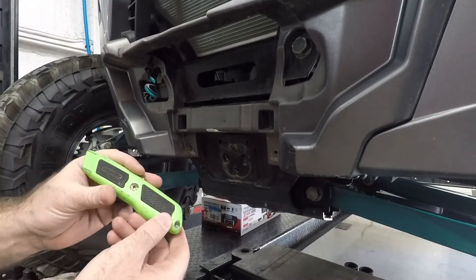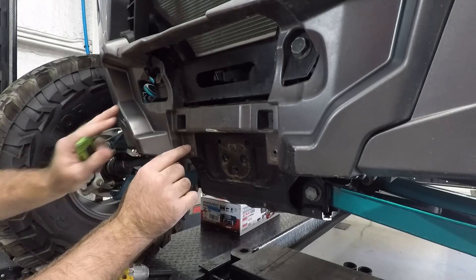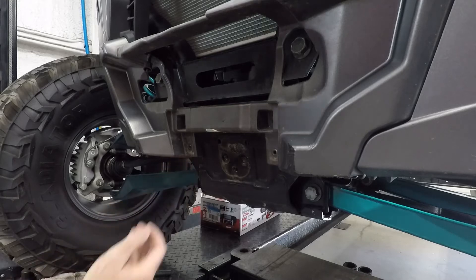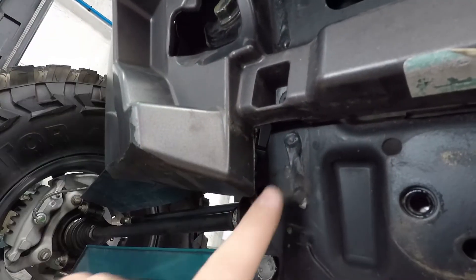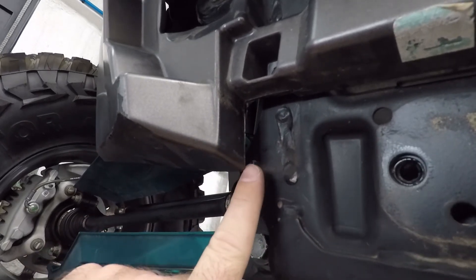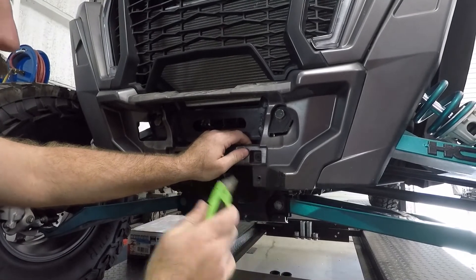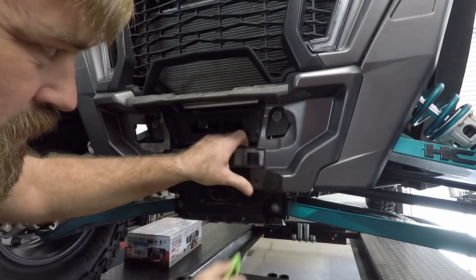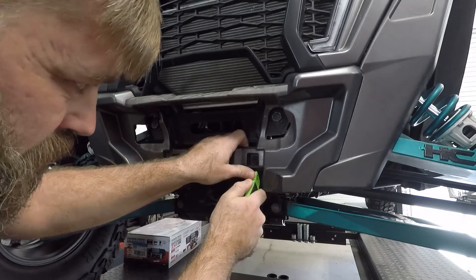The next thing we need to do is use a razor blade to notch the plastic a little bit. These corners right here where those Torx screws went through to hold that front plastic piece on — you need to cut those off. Down under here, you need to cut back just a little bit so that the bumper plate can slide up in there. You can see right here how I notched it — cut that corner plastic piece out and on the bottom just carry that cut over until you hit the edge of the plastic. Remember, always cut away from you. When cutting plastic like this, you don't have to use a ton of force if you just make several cuts in the same spot.